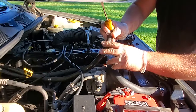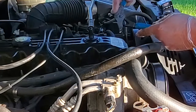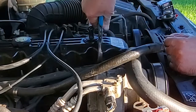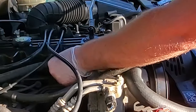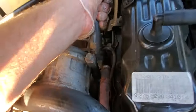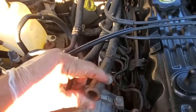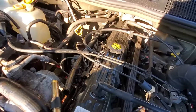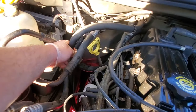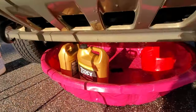This one goes into the heater core — I used a screwdriver for the hose clamp. This one has a stock compression clamp — just give that a squeeze, slide it down, and the return is off. Now I'm going to blast water in through here and catch it coming out the other end. I got my hose looped up over the mirror and down through the hood to take some tension off, and I'm dropping the inlet hose down to catch it all in the baby pool below.